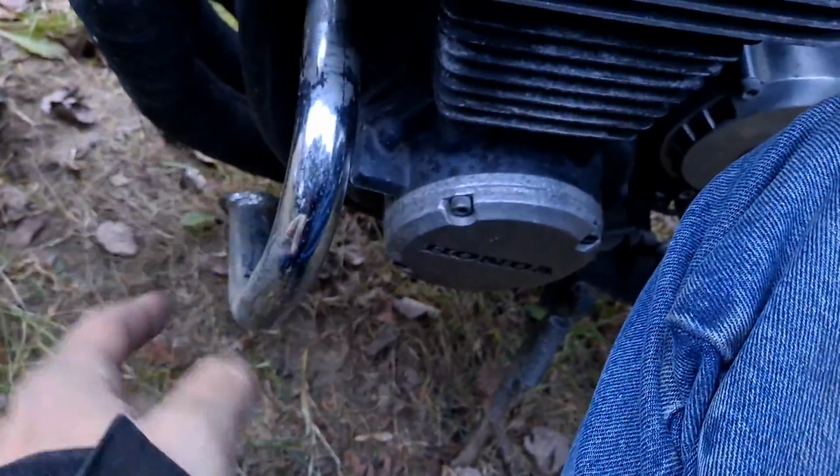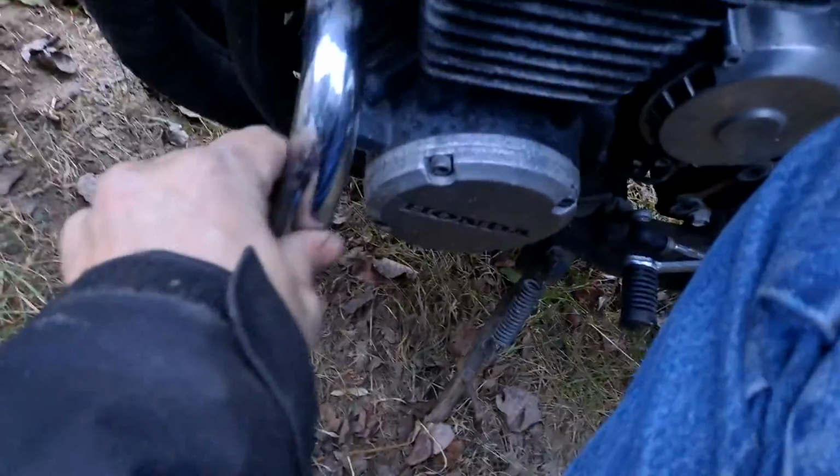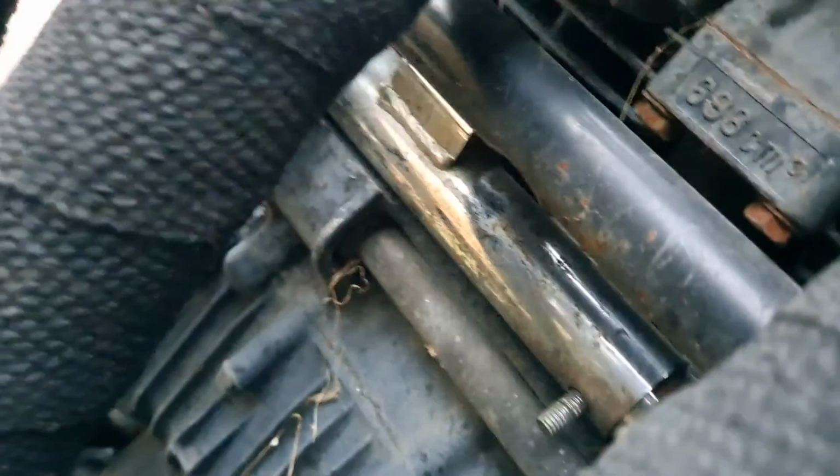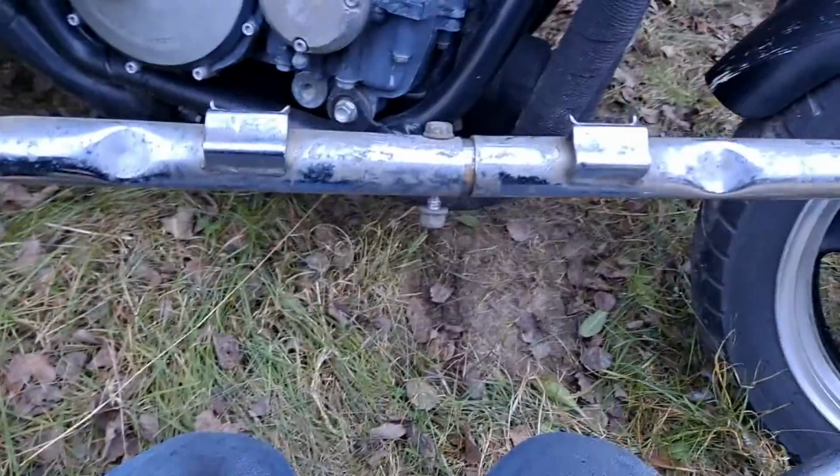But again, you don't do that until you've tightened down this guy, or at least get it snug, because this one does move. And the right side, tighten that down. That one won't move. Once you tighten down the right, tighten down the left, tighten down that center bolt and nut, and then you install your hose clamp here, band clamp there, whatever, and then another one here, and then you're kind of done. So I'll pause the camera again, we'll pull this out, and I'll show you those two sections, and then how to identify this piece.